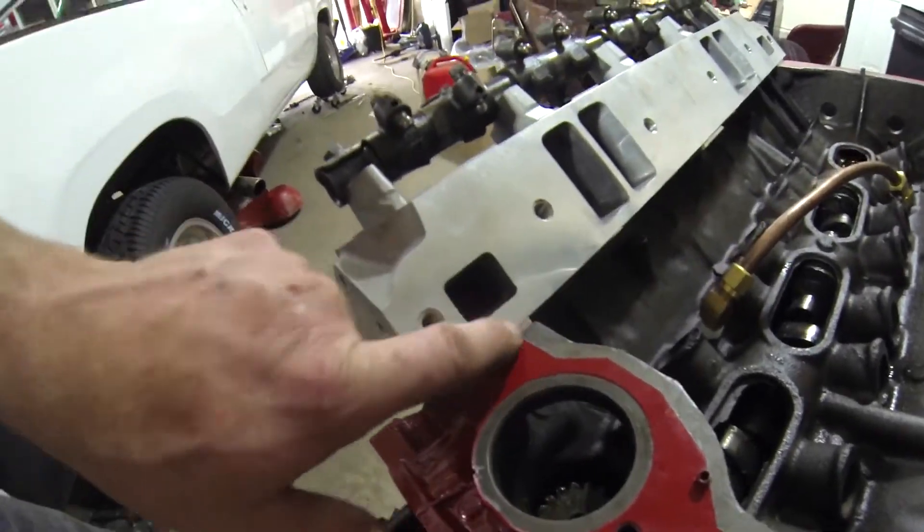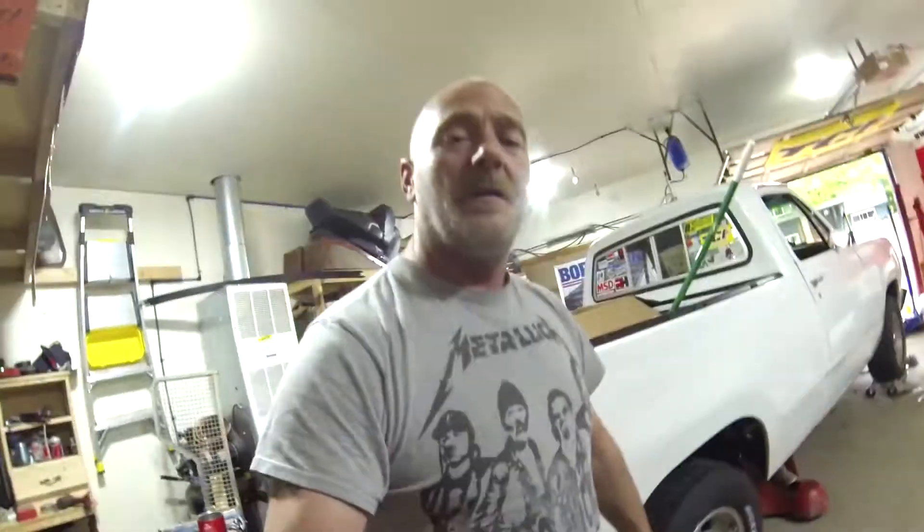So we tried many things. If you take a look here you see this thick spacer — that's actually a 120 thou thick head gasket, and since they stick up approximately an eighth of an inch that would be fine. Except with today's current issues with getting parts, we found that we're not going to be able to get pushrods 120 thou longer, and I'm not about to start cutting pushrods and trying to make something work. That's just a recipe for disaster for what this engine is going to see. So long story short, the only thing we can do is mill the pistons down.